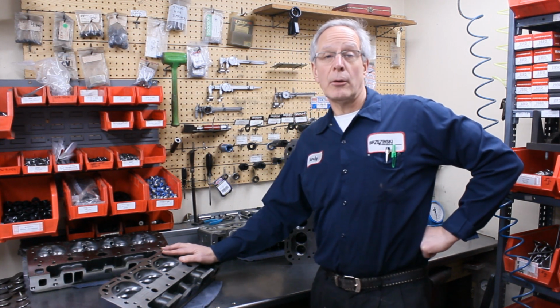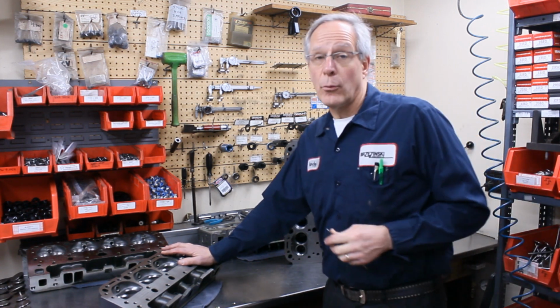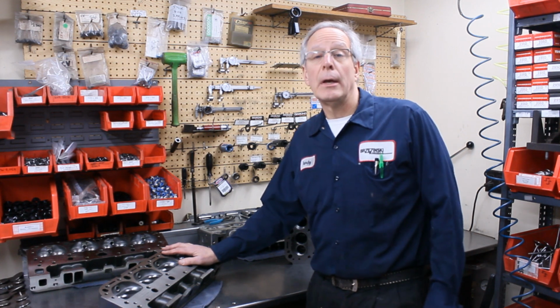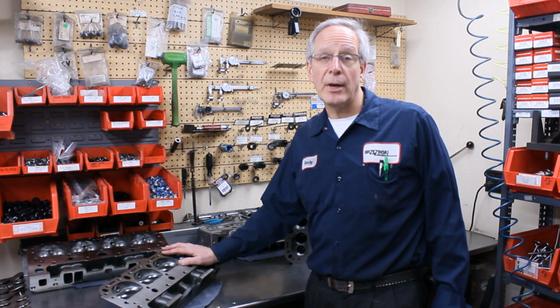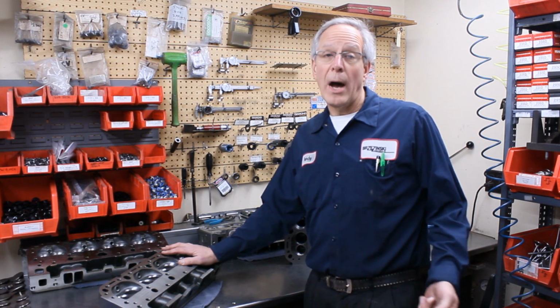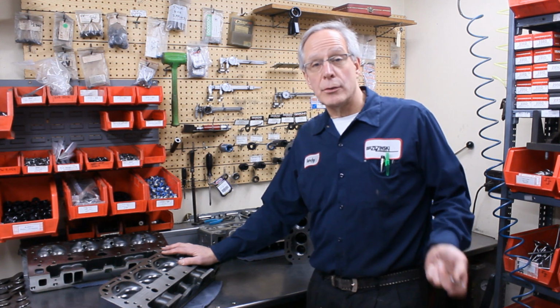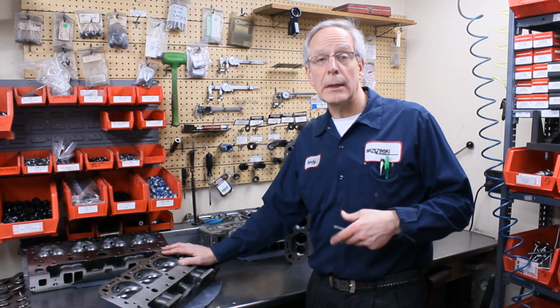So once we're at that particular point, we pressure test the cylinder heads. Whether you send heads into us, even if they're brand new, or we buy heads from whatever manufacturers, we pressure test brand new heads. We have some videos on our website that we'll link to as to why we do it and how we do it. But every head gets pressure tested at least twice, once before we even work on it, and then after we're done working on it.